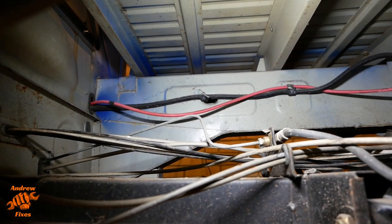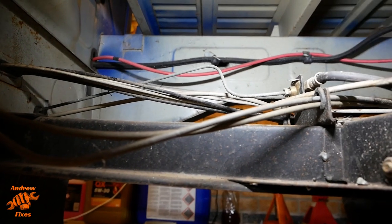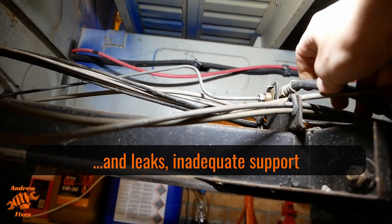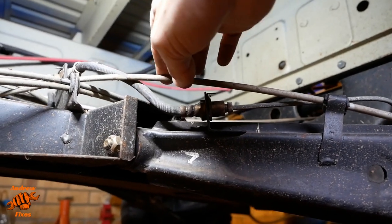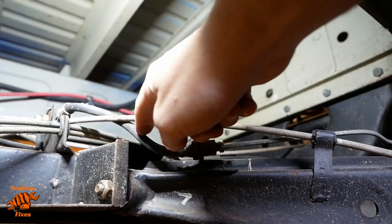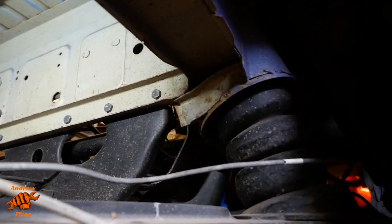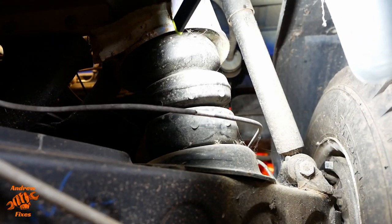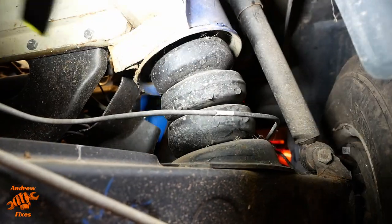Now I'm lying underneath the APE. That's the back of the cab just there, and we're looking at the solid brake line coming to this junction. We're checking the solid lines for any signs of corrosion — these look really good. Then the flexible lines for the same things as before: any perishing, any chafing. This one has a little bit of chafe on there, but it hasn't had any real consequence in terms of wear. Then following the line all the way along and into the wheel cylinder, looking for leaks on the back of the wheel cylinder — and then do the same check on the other side.